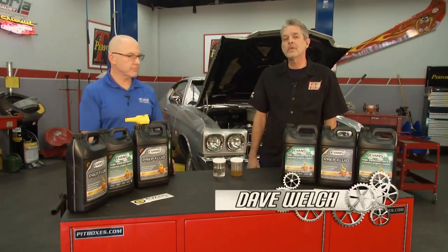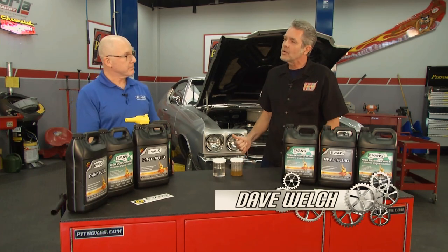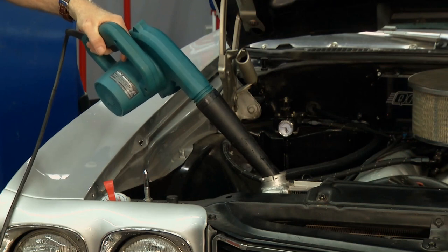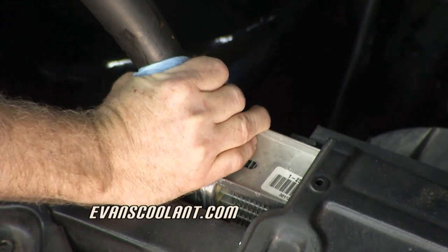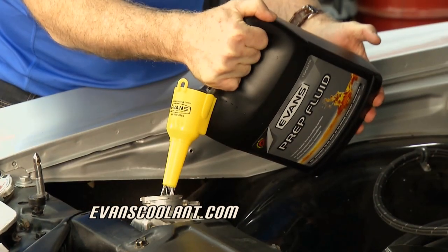Welcome back to Performance TV. We're back with Mike from Evans Waterless Coolant. What do we got going so far on our '70 Chevelle here? Well, we've drained all the water-based coolant out, and then we've used forced air to blow any residual coolant out of the system because there's always some of that left behind in the nooks and crannies. Right. Then we fill the system with prep fluid.